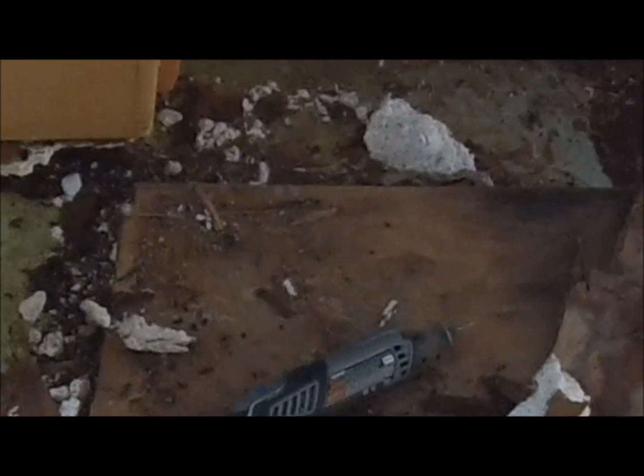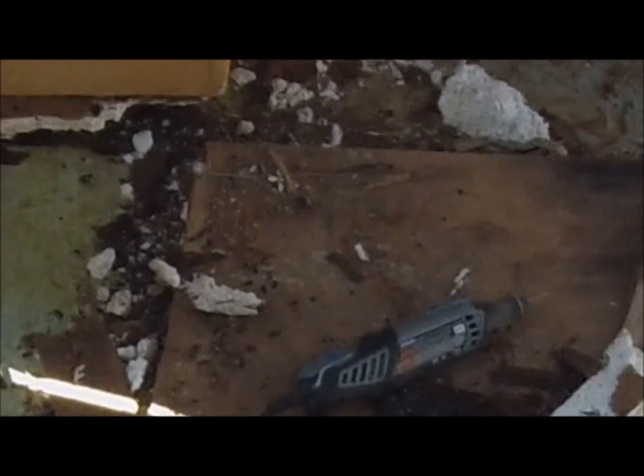So what I'm going to do is mill down some 2x4s the exact thickness from this beam to the bottom of my plywood floor, which I believe is 3/8. I'll verify that and let you know later. So this 2x4 will lay on this beam all the way and butt up against this plastic PVC channel, whatever it is, that the electric runs through. When you're cutting this floor out, be careful, don't cut through this into your electrical cable.